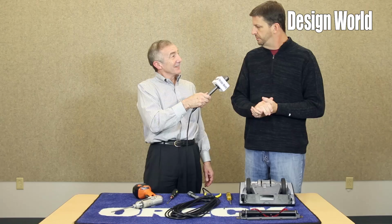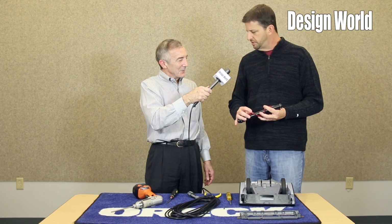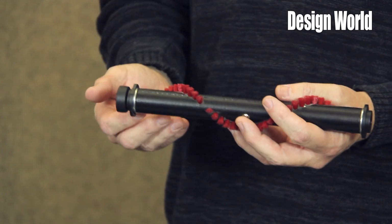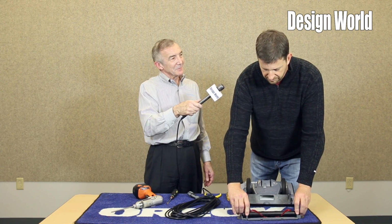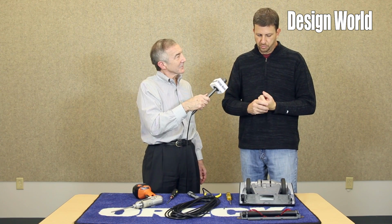That is a metric that we do measure. We do measure carpet fiber pickup, carpet damage. That has more to do with the bristle aggressiveness: the height of the bristle, the diameter of the bristle, there's a crimp pattern on the bristle. All of those things play into how much damage you're doing to the carpet. Of course, we always strive to minimize any kind of negative impact. These units have passed the CRI, the Carpet and Rug Institute seal of approval, which means that they're very good on carpet abrasion. CRI measures carpet abrasion, debris pickup, and sound quality.